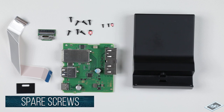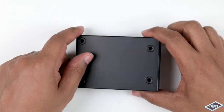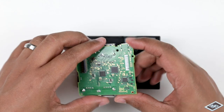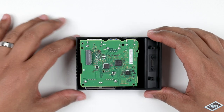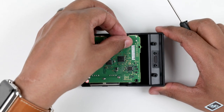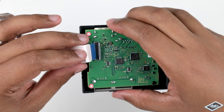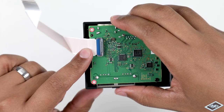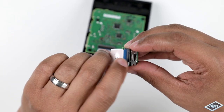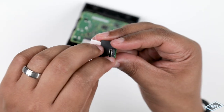To complete this project you'll repurpose these parts. Start with the top half of the replacement case. Slot the board in like so. Insert screws as shown, ignoring the slots indicated. Insert the ribbon cable at an angle and then down. Close the locking flap. Insert the other end of the ribbon to the docking connector and close the locking flap. Slot the protective sheath over the docking connector.